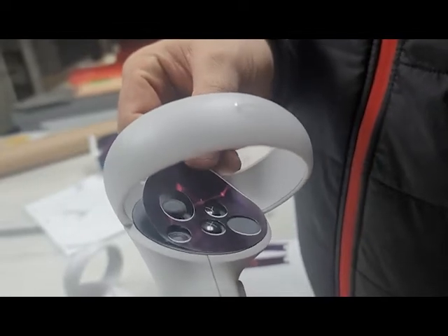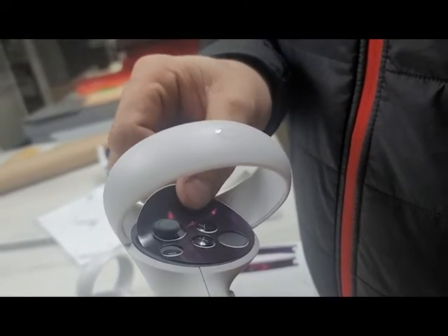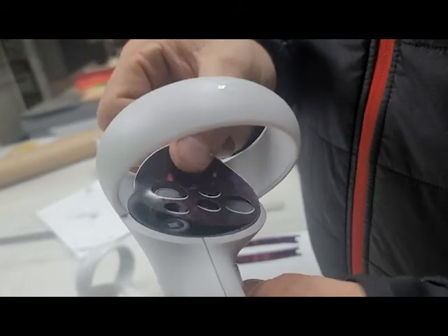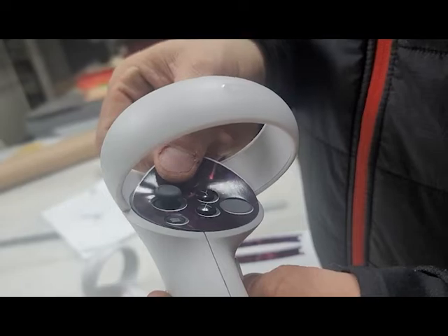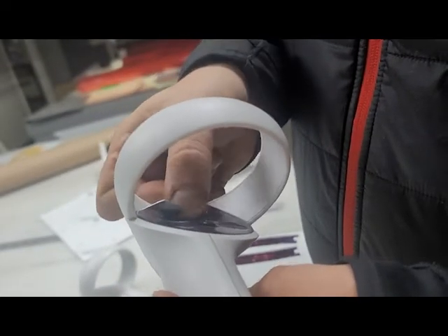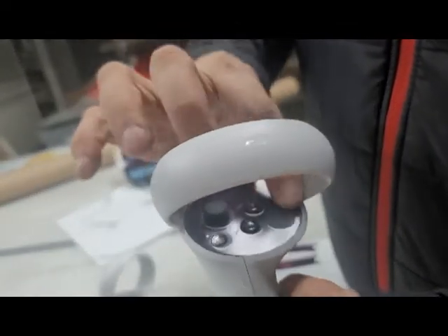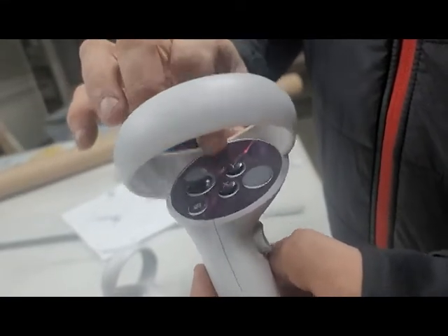Our vinyl is a 3M grade vinyl, so you can actually just float it — it has an air release on it. You can float it back and forth until you have it in the position you want. And like I said before, if you get lots of wrinkles, you can actually slightly pull it off, flash it with heat very fast — just one second with a hairdryer — and then it'll flatten back out. See how I floated it there? You can do that with all the parts. Just float it until you have it in place, work it in, and there you go.